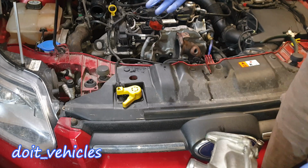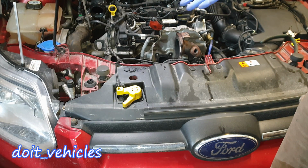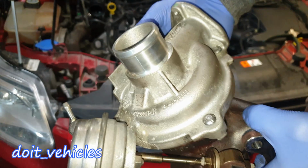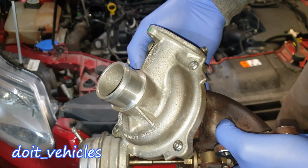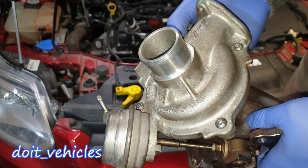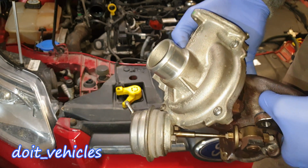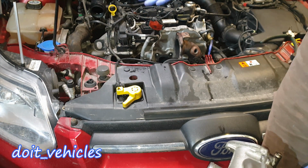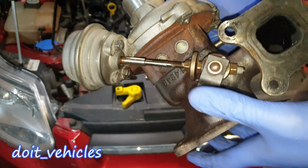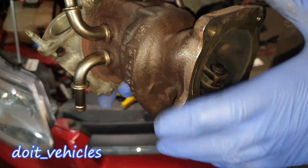However, all engines also have limitations, because you cannot pump unlimited air inside there. So, for example, this is a 3-cylinder, 1 liter engine. This turbocharger is quite small, but is enough for 3 cylinders. And just for your curiosity, it's not enough to swap the turbo for a larger diameter one and you'll get more power. You also have to tune the computer to register that change of extra air. It's not as simple as that. But anyway, for today, let me now show you the components of it, which are quite simple and straightforward.